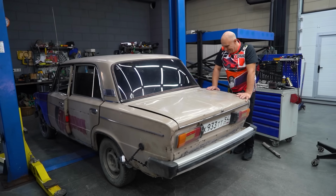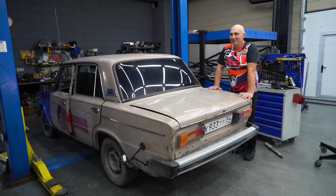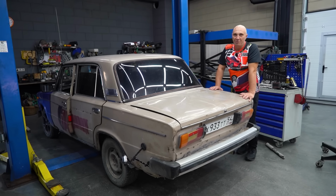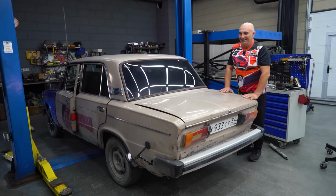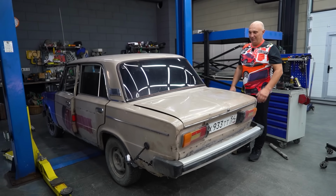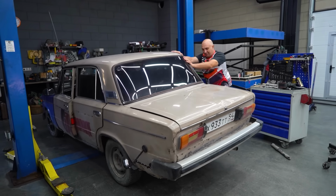Regardless, the pistons now have two extra holes each. You get the picture. Eh, no big deal. We can always block off one of the holes, bore it out, tap some thread, and put a screw in it. Sergey. Okay, they work, I'll give you that much. Now I just need to go for a drive and see how they perform out on the road.